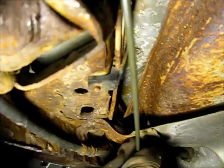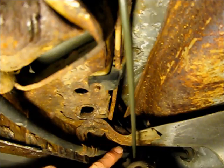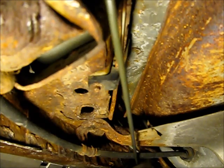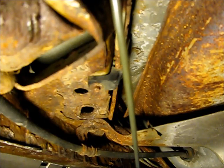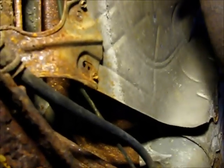That's not too bad. Now it's going to be a matter of getting these bends to contour through here. It has to go underneath this protective pan from the muffler. I'll get the bends pretty much where I want them, make another one right here, and then the final one that follows along the underframe. The original lines are here — I'm leaving the other lines intact and not going to disturb them. Brake line is pretty much where it needs to be. Don't forget to put never-seize on the threads and on the fitting. Got it down under here, running underneath the shield. More bending can be done by hand underneath there.